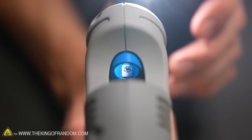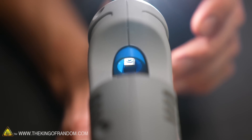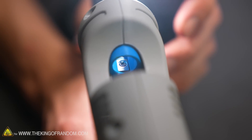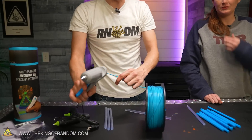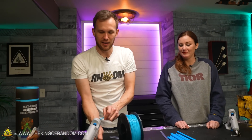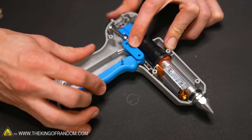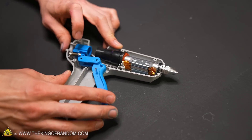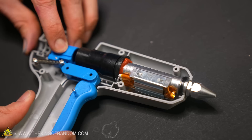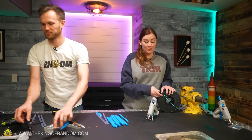That piece acts as a ratcheting system. On cheaper glue guns, it won't even have a moving part — it will just be very slightly barbed inside. So that lifts up, presses against the glue stick, and when you squeeze more, it pushes the whole glue stick forward, forcing hot melted glue out the front nozzle. If you have a piece that's too thin, like this filament, you can fit it in there but pulling the trigger isn't going to do anything. This is a high-output gun — you can buy these at Walmart for about 14 bucks. It's got two parts: the first action lifts up the ratcheting piece, then you keep pushing and it pulls the whole thing forward, then slides back and grabs more glue. I've got this glue gun nice and hot.